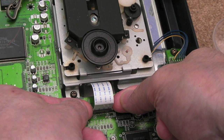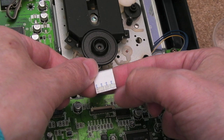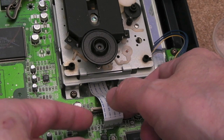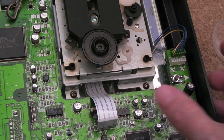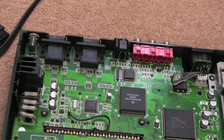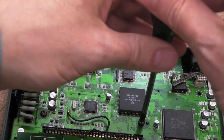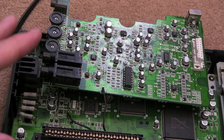Let's disconnect various things. This flat flex here — you just need to gently lift it up on each side of the connector and the ribbon will come out. You can see it's looking a bit oxidised — it might be that some of the electrolyte from around here has got to it. There's a little JST connector at the back — let's pull that out. We need to remove the screws that support the motherboard, paying close attention to the colour and size because they're going to vary around this thing — you wouldn't want to put the wrong screws in the wrong positions.